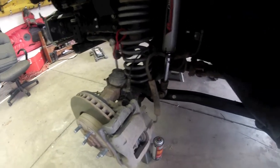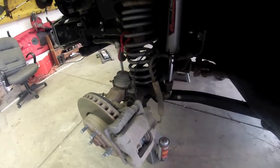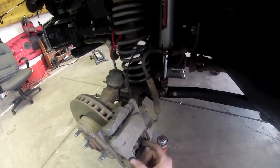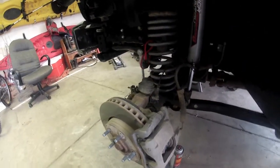One thing I do caution you with before you get going, just driving straight out of your driveway and down the road, is pump the brakes 3 or 4 times in the driveway. It'll feel kind of soft at first, and that's just this plunger kind of pushing everything all back together. So pump them 4 or 5 times until they firm back up, and then go ahead and start driving. You should be just fine.